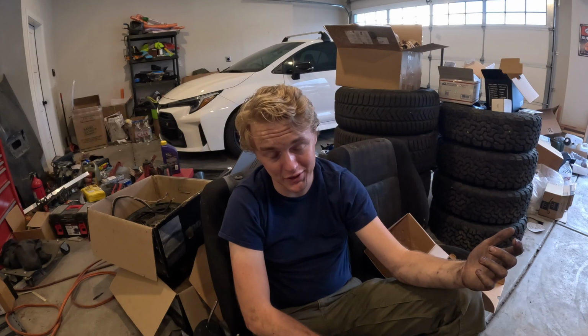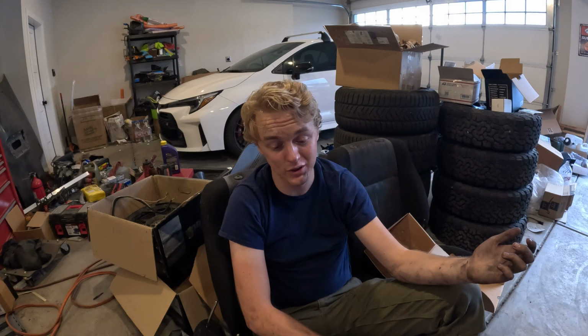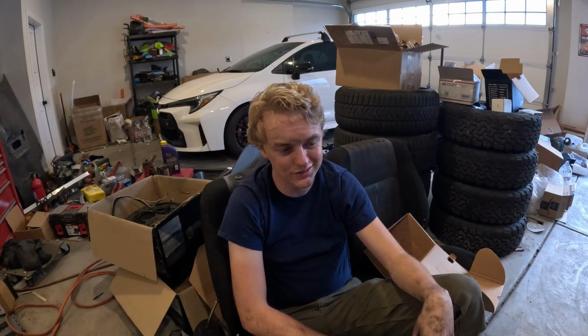That being said, the build series is starting a little bit early. I think the next thing to do is order a set of gaskets, start putting on the manifolds. As I'm doing that, I'm gonna do the fuel systems. You'll learn about that. Everything's going to AN. I'm taking the stock injectors out, putting ID1050s in, Radium fuel pressure regulator, the billet fuel rails, all that fun stuff. And I'm gonna wire up a Haltech Elite 1500 because I have no clue how to tune the piggyback that's in this. And frankly, it's just not worth it. So all that stuff's on the shelf. It's just a matter of doing it together, I guess.